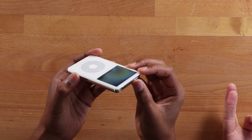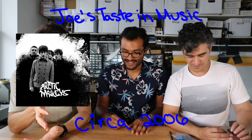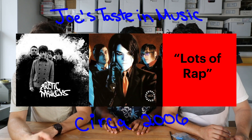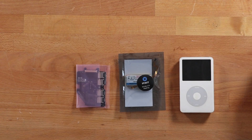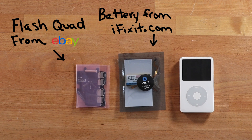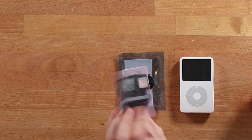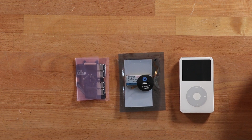So there are two problems with this right now. The battery life has decreased over the years, over the long time. And your amount of music has increased a lot, so it doesn't fit all your stuff anymore. Plus the hard drive in there is going to make the battery life shorter because it's an old hard drive that moves. Where did you get this repair kit? Part of it is from eBay — I don't know who makes this, it's a flash quad — and the other part is from iFixit. They sell repair kits and batteries for this thing still, one of the few people selling batteries that won't make your iPod explode because they're fake.